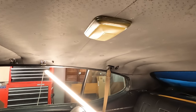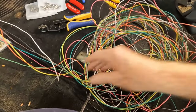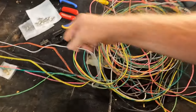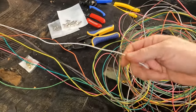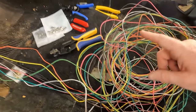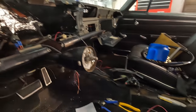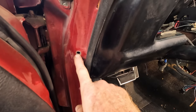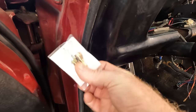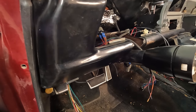I did have to pick up extras. So the first thing I need to do is the dome light. Even though this is the taillight section, the dome light is still part of it. I believe it is this white wire — yep, this is the dome light power wire. There is also a black ground wire. What's going to happen is this white wire will go to the dome light — it's full-on all-the-time power. The black wire is the ground that comes out and either goes to the headlight switch or the door jambs.